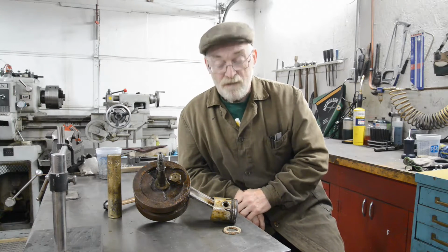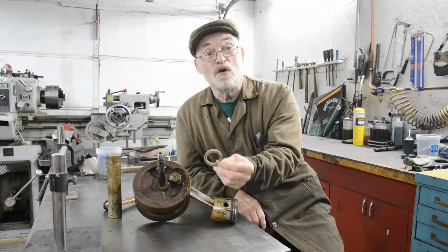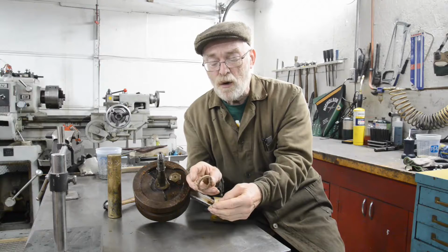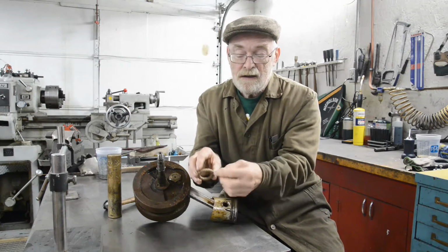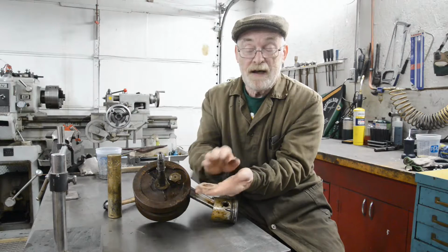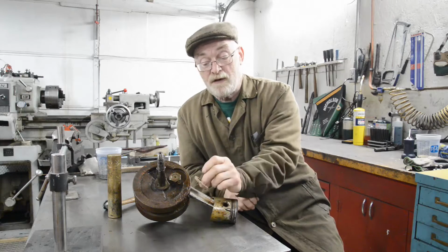Alright, first of all, that is what passes as the oil seal. That's the cork seal that would go inside the cases. You remember we put a washer in, and then the cases had that little step in it, a small washer would go in that, then this would fit into that step, then a bigger washer would go on, then the bearing would go on. So that was the seal. So I'm glad we're putting an outside proper spring-lipped oil seal in.